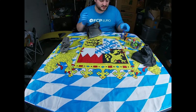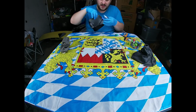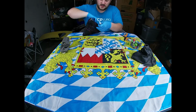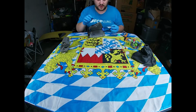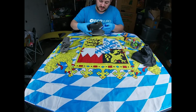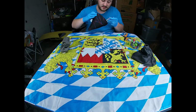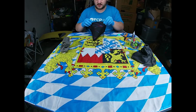So we're going to start with this bottom side here. Uncap your glue, and you're going to glue on the outside of the frame, which is the fabric side. You're going to glue from about these two brackets here, so two prongs that clip into the console. Again, on the outside, you're going to run about 3 or 4 inches of a tiny thin line of super glue, leaving the corners and the radius of the corners undone.